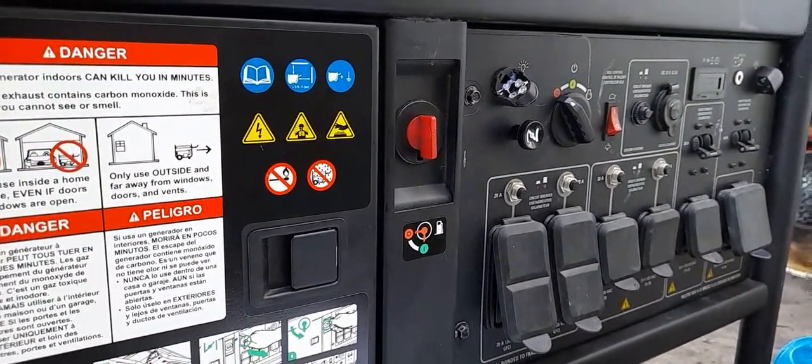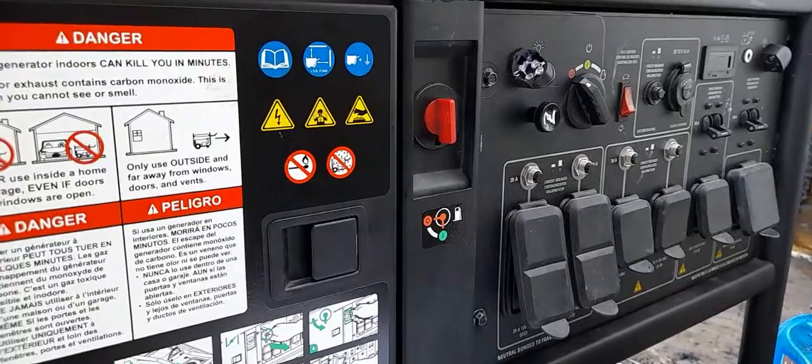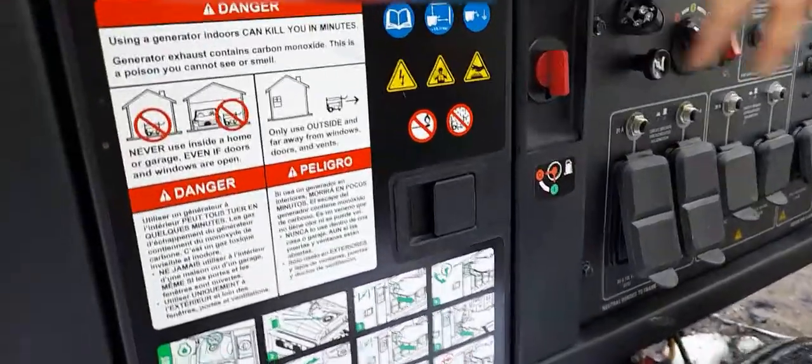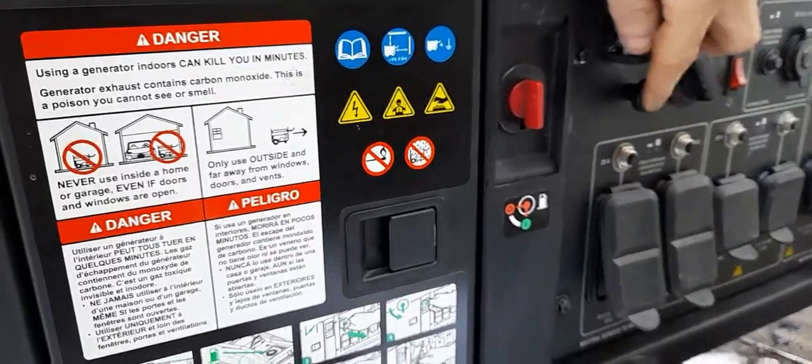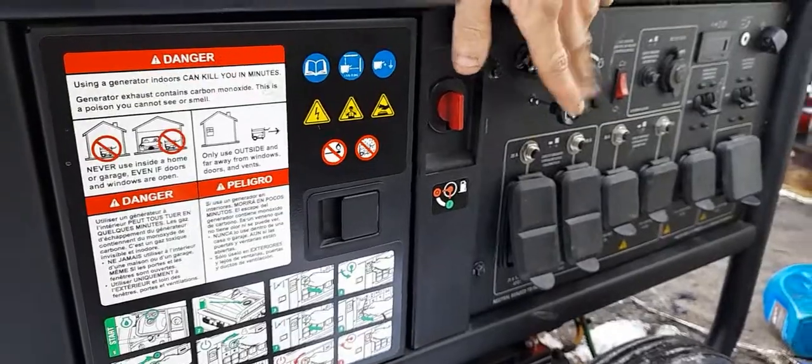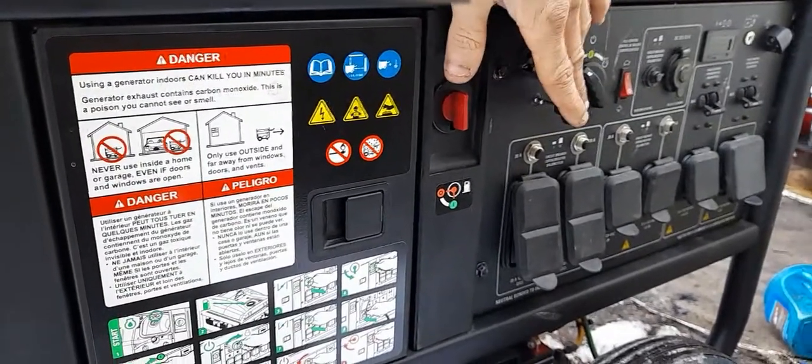So that's how you cold start. Most times with these Chinese clone engines, for a hot start make sure you have the choke lever out at some point. If they're cold you have to leave it out a little longer than if it was warm.